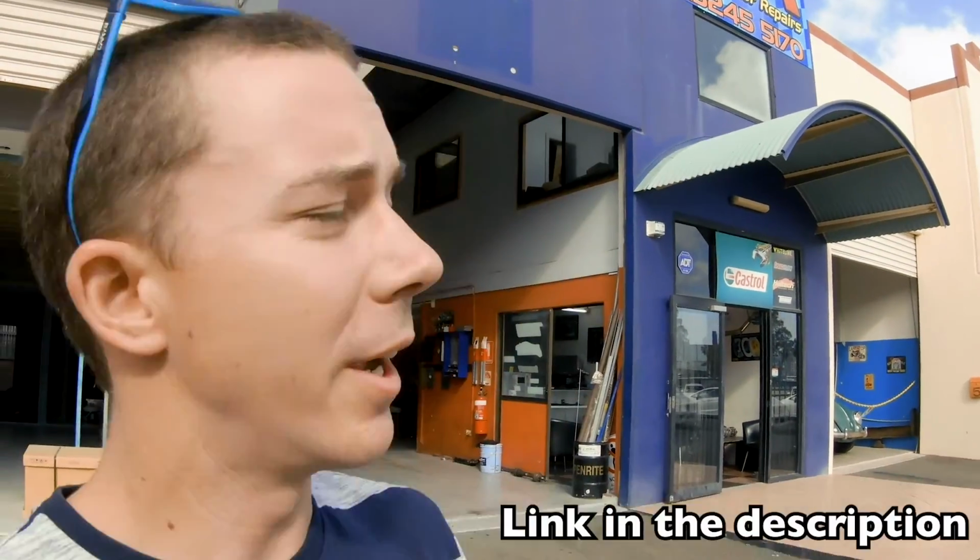This morning we're over at Capalaba Motor Repairs and we've brought the EVL86 down because we believe it's down in power. It's also got a heavy exhaust manifold leak, so get it up on the hoist now, check it out, and then chuck it on the dyno to see what's going on. We definitely know it's down in power because we were looking at data on it, and the acceleration curve, Queensland Raceway sprints where it's all about the power, is drastically different.